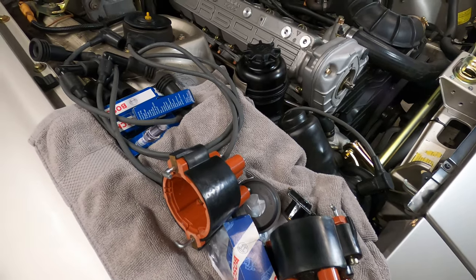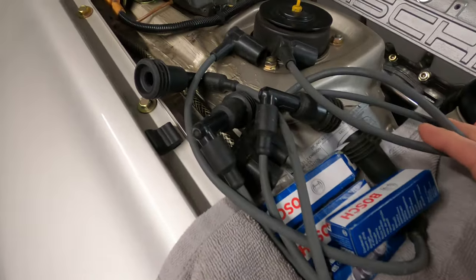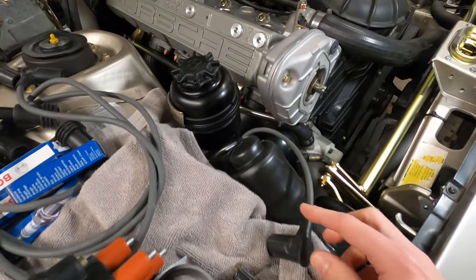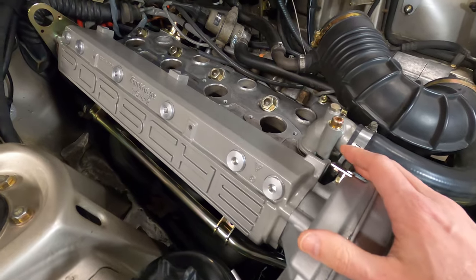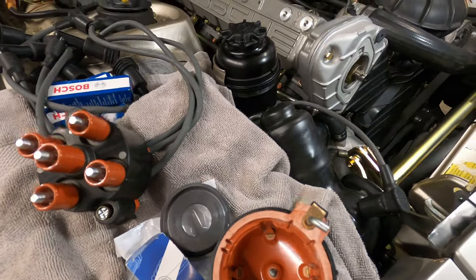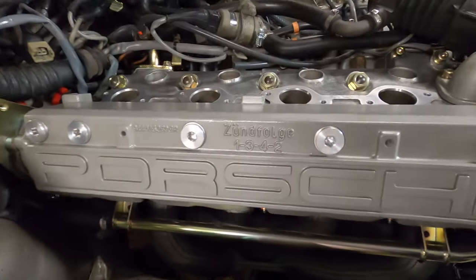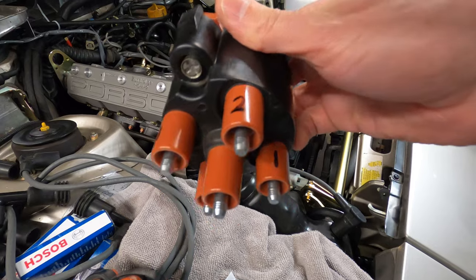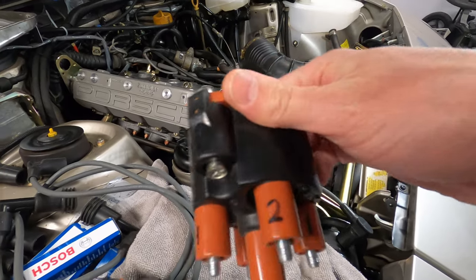With the distributor cap in place, you can go ahead and reconnect the spark plug cables and the ignition coil cable. Make sure that the routing order matches the number of cylinders, numbered from 1 to 4 from front to back, and that it is aligned with the ignition sequence, 1, 3, 4, 2, which translates as 1, 3, 4, and 2 on the distributor cap.